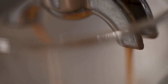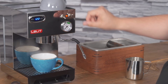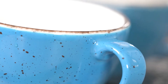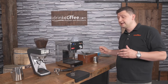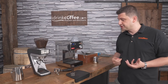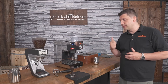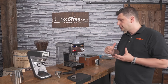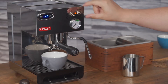We need to bring the machine back down into brewing temperature. I'm going to put it into brewing position — the bottom position — and run some water through the group to also refill the boiler. You can see how hot that water is. The reason I did that is to cool the machine back down to espresso brewing temperature. Now I'm going to give it a few seconds to stabilize at 90 degrees. It's going to go a little bit below because I did introduce cold water into the boiler. This light right here is the heating element light — when that's on, the heating element is on. That's the PID at work — it's turning the heating element on and off to achieve a certain temperature inside the boiler. I'm at 90 degrees, so I'm comfortable to start brewing right here.